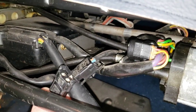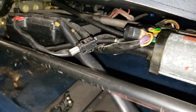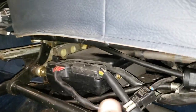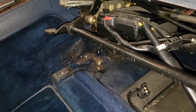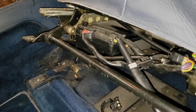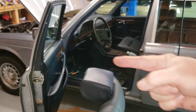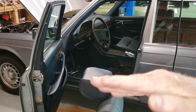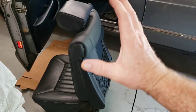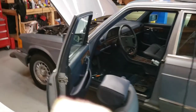I just disconnected this small harness here — I don't know what it goes to but we'll find out later. And we've got this guy right here connected in two places — there and there. Pretty much standard Mercedes stuff. Oh man, look at that, that's pretty nasty. Let me get these two connectors off and then we'll pull this seat out of the car. You move the seat forward a little bit, then instead of tilting the top out first, you lift this part up first, tilt the seat, and pull it out over the door seal.